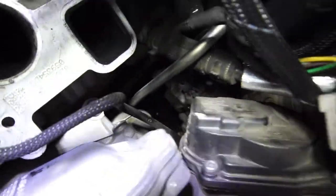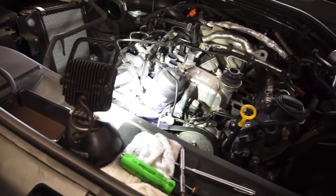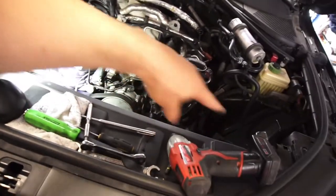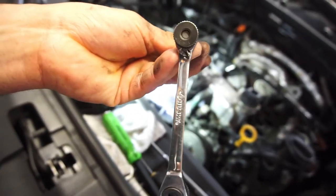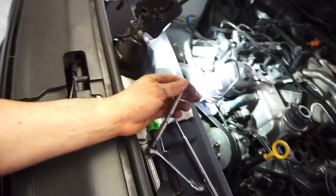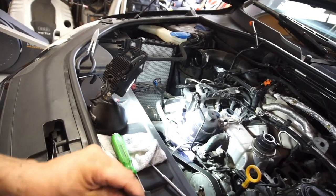I see a lot of wet spot down there, so I can get better access to all this now. I didn't want to bore you guys with all the video of tearing it apart, but it was a pain in the butt. Start off by taking off the intake tube that comes to the throttle body. The intake bolts were a pain - get yourself a quarter-inch drive ratchet. The standard bolt on this is a T30.